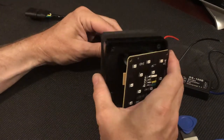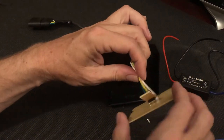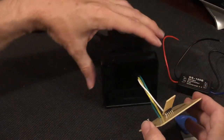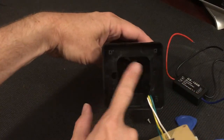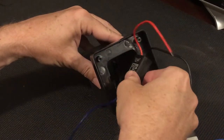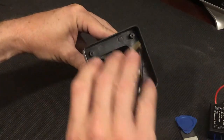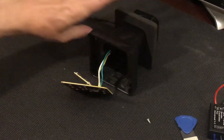When I take off the screws, the back of it is extremely simple. And then there's one integrated circuit module attached to the back that solders through the board to reach those leads. So I'm just going to be super careful with that. But this gives me this great big wide cavity inside that I'll be able to install the strobe module inside. It just exactly fits. And so once I attach the wires, shove it inside there and seal everything back up again, I should have a strobing module that looks exactly like the original.